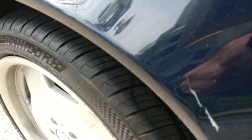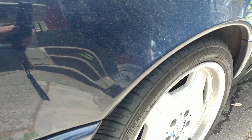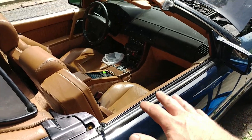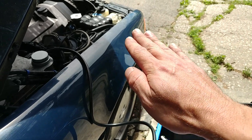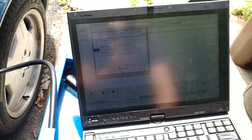At the rear - on one side I can push the suspension about two inches, but on the other side it's barely moving. That accumulator is bad. What happens is when you drive over a bump, the rear jumps more than the front. I just had that same problem on one of my own cars - both rear accumulators blown - and it was terrible.